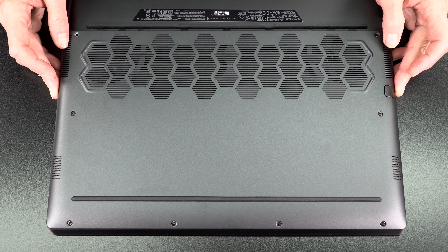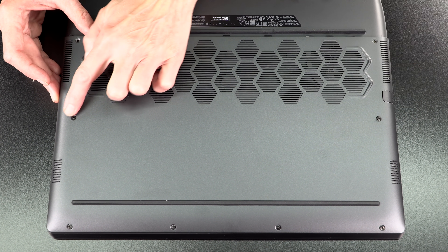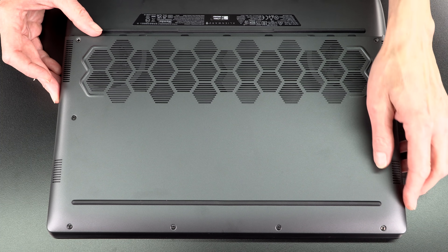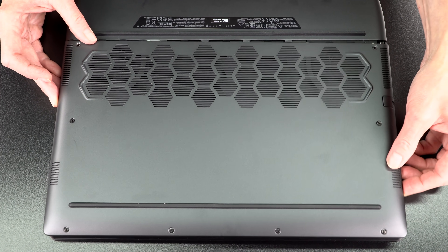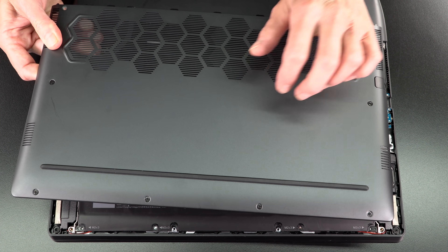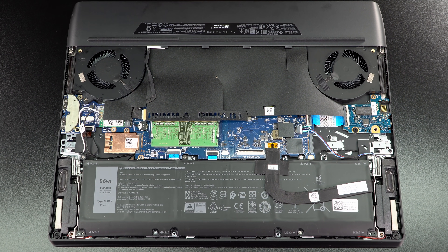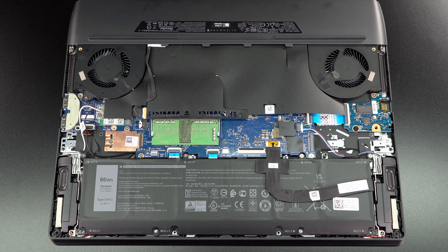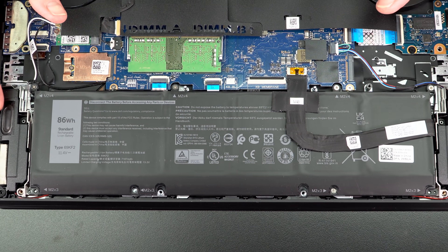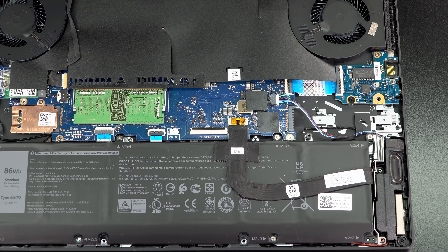Getting inside is easy — no really annoying plastic clips. Some of the screws are captive, and two are longer screws, so you probably won't put them back in the wrong place. Just unscrew them all and lift up, and the bottom cover tucks under just like Alienwares always have. The bottom cover is a combination of magnesium and aluminum — this is a metal laptop, not plastic despite the paint. Inside, we have our 86 watt-hour battery, two speakers with two-watt drivers. The sound is just okay — not much bass, volume is reasonable, so you'll want headphones for a more enjoyable experience.